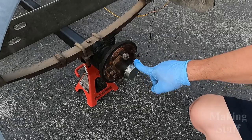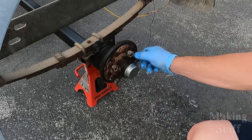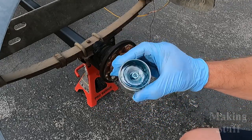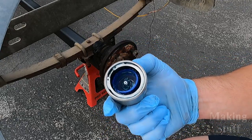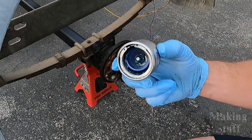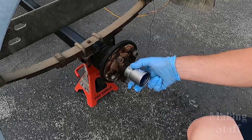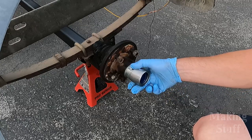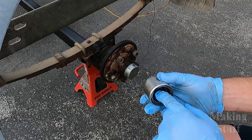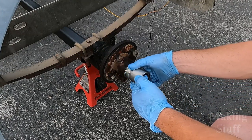All right, so you can see here that I have put the original dust cap back on this hub. That is because I either got a defective bearing buddy. You can see here how it is pushed in and not really working the way it's supposed to. I did have it on there. I put the grease gun on there and I tried to fill it with grease and it just stopped, like the Zerk fitting was clogged. No matter what I tried, no grease would go through it, and it certainly wasn't pressurizing the inside and pushing